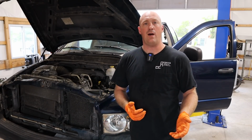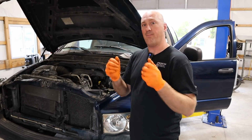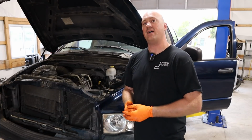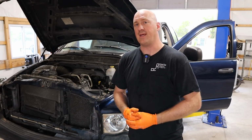Now, if you've watched this channel for a while, you know that one thing I like to do when I get the whole entire thing back together again is, before I do anything else, I go ahead and hook up my little code scanner. Whether you want to use a better one or even a cheap one is just fine, to look for any codes, because oftentimes that will tell you if you missed one of the electronic plugs or something like that, and then you can really quickly jump out here and click it in before the engine gets all hot from running it.